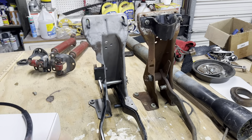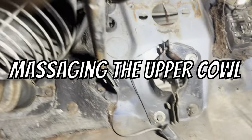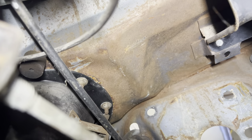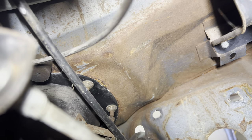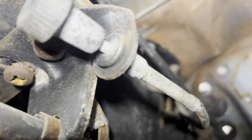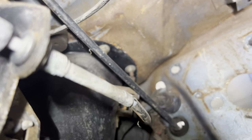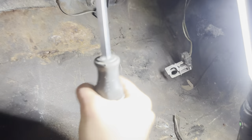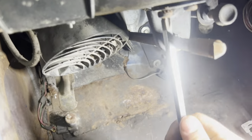Just want to show you what's going on under here. There's a mark here that represents a bump in the cowl panel, and you're going to need to do some massaging on that. In order to do that on this one, I'm going to be adventurous and take out this vent — that'll also give us some room for the electric steering system. Oh, the fun of removing a vent — there's usually like Chewbacca hanging out inside here.